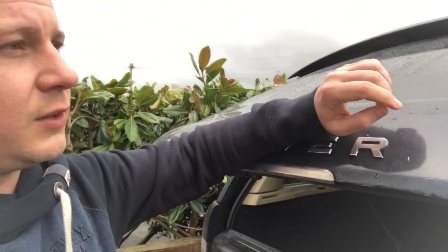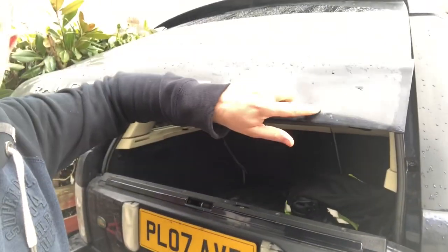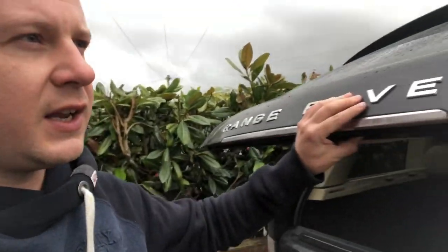Is it clean? Is it free from rust? Has it been driven in salty conditions? The way the water runs off on these, you get rust on the edges here and on the other edge. If you look just under here, can you see there are drain holes? There's a drain hole and another one on the other side as well, where water will run down on the inside of the bodywork and rust it from the inside out. They all will eventually, but you just want to have a good look and see what the condition of this one is like.